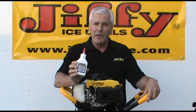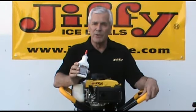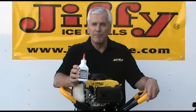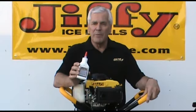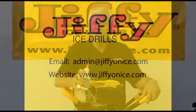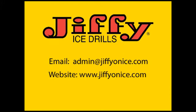We highly recommend that you check the oil before each use, and also make sure that you change the oil at least once a year. So those are the recommended fuel and oil recommendations for the Jiffy Model 4G powered by the overhead valve 4-stroke engine. If you have any questions or concerns regarding this, please feel free to contact us anytime at the 2 locations noted on your screen.